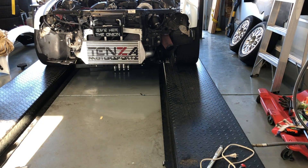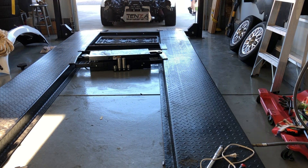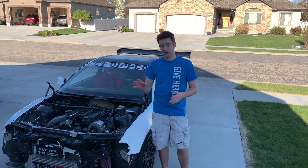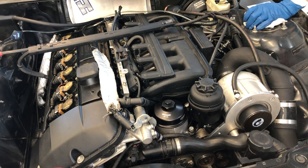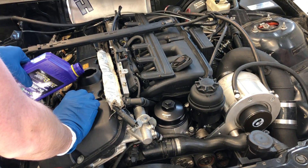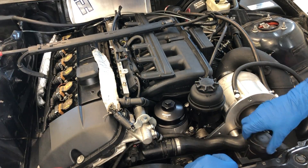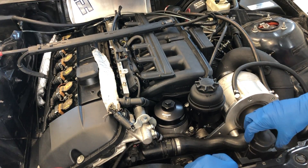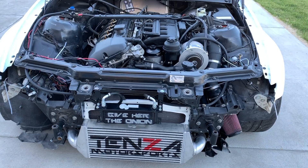I am very excited — I just got it rolled out of the garage, it started up perfect the first time. We let it run until the cold start was over, then I went through and checked all the fluids, made sure everything was good, and topped everything off. As it sits right now I still do not have the coolant system bled. I didn't actually lose any coolant during the first couple starts, so I'm just gonna keep a really close eye on that.